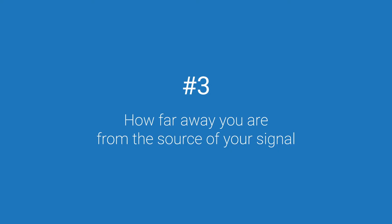We've talked a lot about WiFi, but one additional item to confirm about your wireless card is that it has Bluetooth on board. Bluetooth is great for connecting wireless peripherals and other devices directly to your computer. Like WiFi, there are multiple Bluetooth versions, with the most current being version 5.2. Bluetooth is also backwards compatible, meaning all versions can interconnect with each other. However, as with wireless internet, you may lose some features when connecting to a previous generation device.